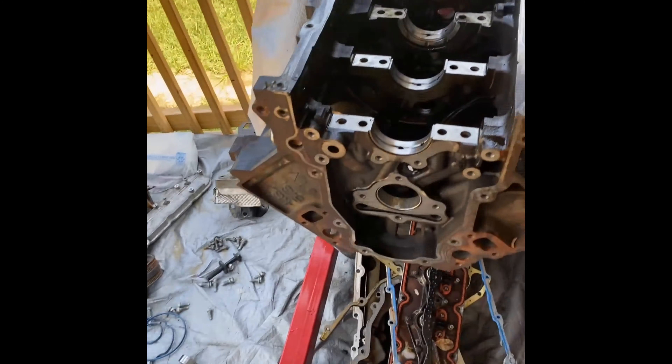That's what I think happened — heat it up and expand the damn bearing so I couldn't get it out. But I wonder if that holds some good though. Even though the cam is messed up on the second hole, I wonder if that holds some good so they can replace the cam bearing. I hope it's still some good material. Guess we'll see — I'm probably taking it to the machine shop.